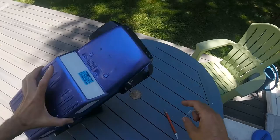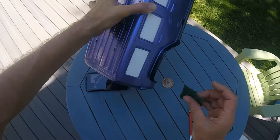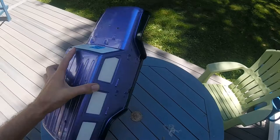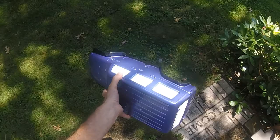I'm going to finish getting all this off. This side's done, going to do the front, got to do that side. I did do around the taillights — I'm going to paint them black — and then I'm going to scuff everything up with the 3M pad. Be careful, stay away from the edge, just scuff it real lightly so the paint has something to bite into. We'll get back when we're ready to spray the semi-gloss black on the outside.